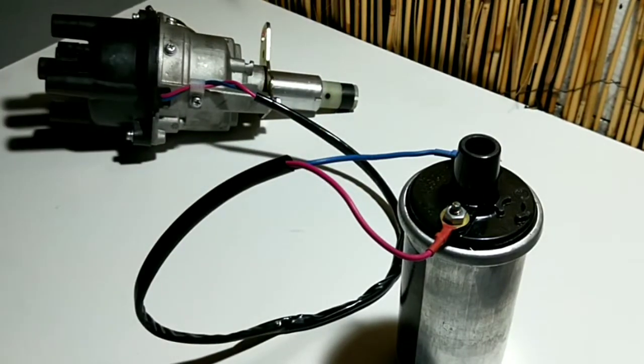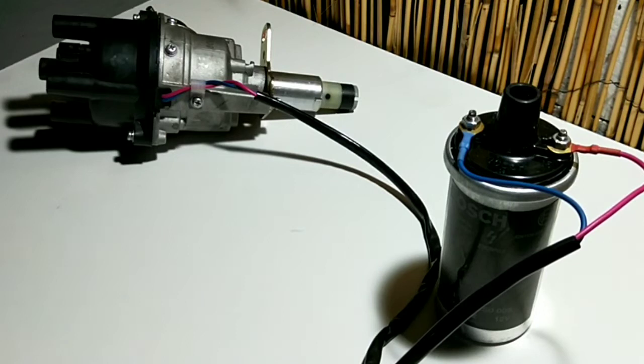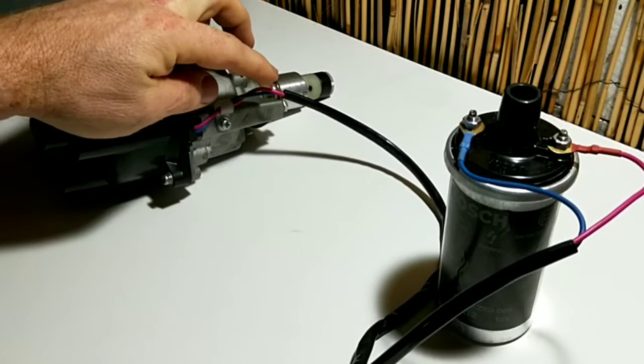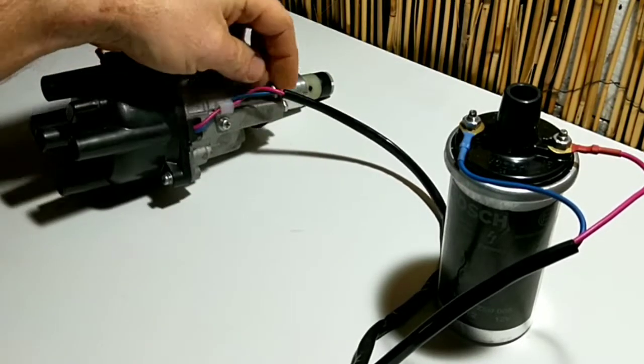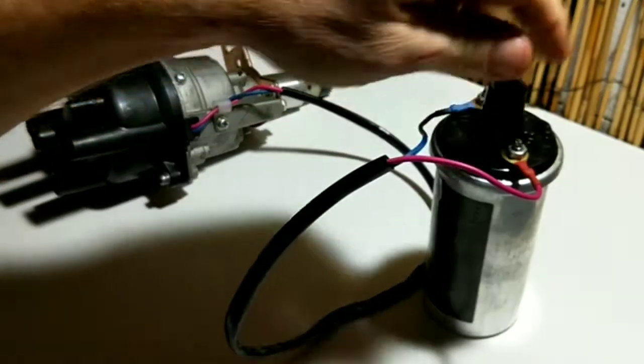It'll be different to a points coil in voltage. The points coil will probably still work, but the performance might not be there and the coil probably won't last as long. But wiring is as easy as the positive wire — which is usually red, but could be blue or black — positive goes to the positive side of the coil.